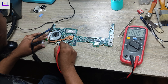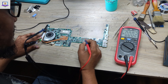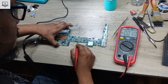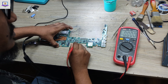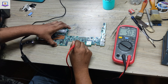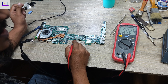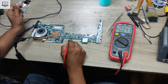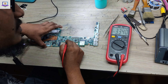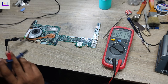I set my multimeter in DC mode. First I check here — we have 18.97 volts, that is 19 volt. Then 3 volt and 5 volt should be on these two rails. 3 volt is not present, 5 volt is present. I guess this 3 volt is a suspension voltage that generates after pressing the power button. If I check the LDO, 3 volt is present there.